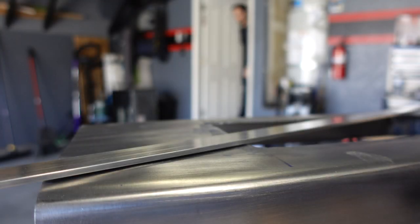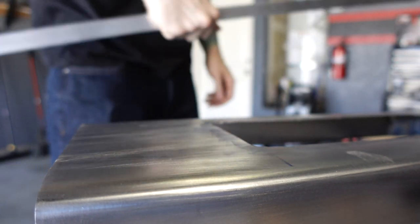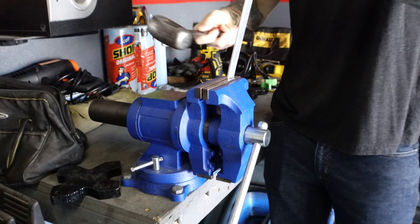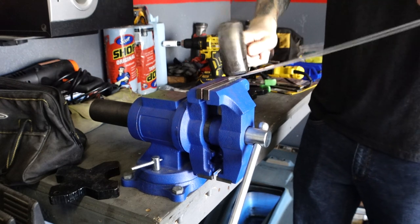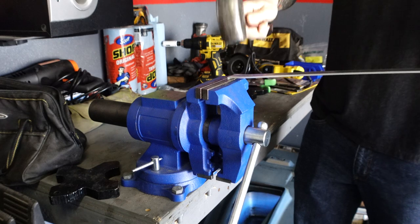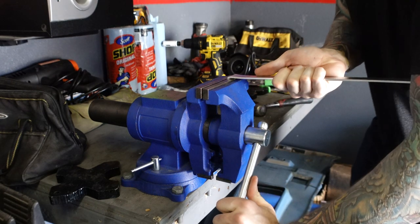First thing I'm doing today is building the rear mount. This is going to be pretty simple, just a basic bracket that's going to secure the console to the truck. I decided to use aluminum here because I don't need to be making this out of 1/8-inch steel for a piece of sheet metal that weighs less than a pound. And it's easier to work with. I don't know, I'm just learning as I go here. So much easier than steel.